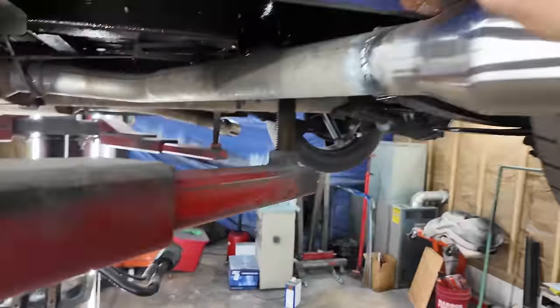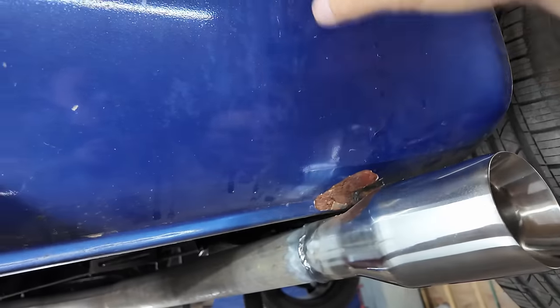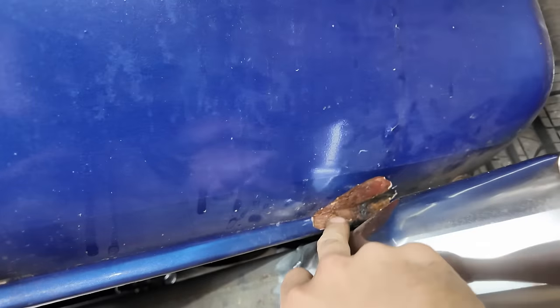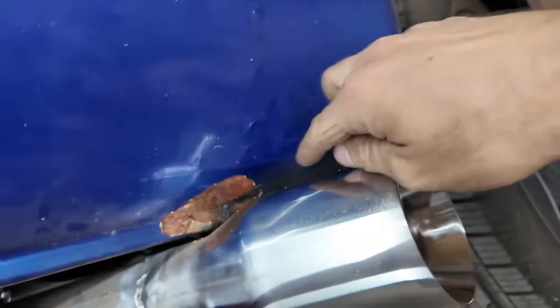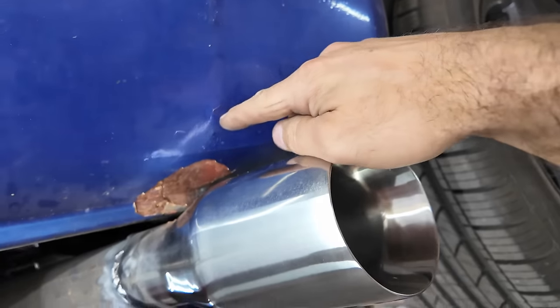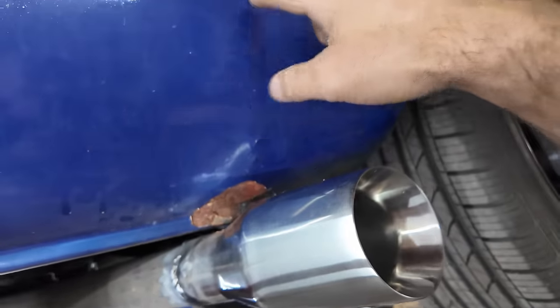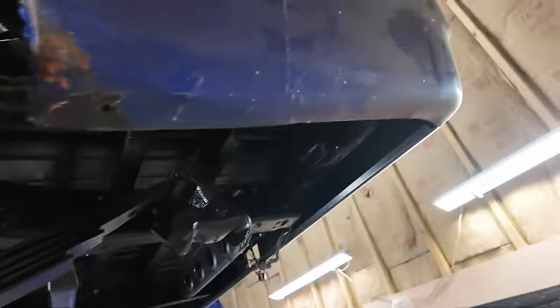So I was up here, I re-welded the patches on these bedsides and it bubbled the paint. Well, somebody skim coated this whole bed to work these in, and the putty was coming off. So I went ahead and cleaned that off. I'm going to have to take this down to bare metal and re-do the bodywork all right here. As you can see, there's a bubble right there, so when I welded it, it messed the bodywork up. But we also have it back here.